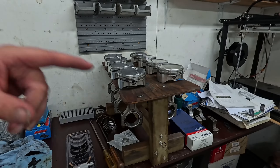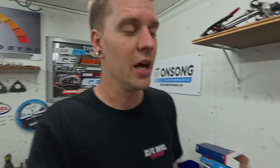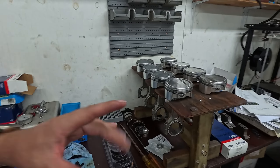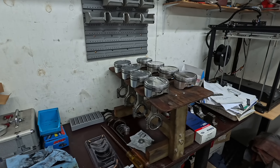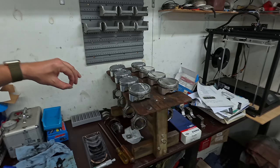As well as that, because it came apart, I had some issues with the big ends. Spent a lot of time fettling bearings, getting the big ends all perfect, only to start double-checking diameters and finding they weren't as round as I'd like — given how much effort had gone in. I had them resize all of the rods. All the rods have been resized, rerounded, and I did get them to hone out the little ends a little bit. Just make everything a bit nicer.